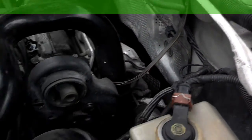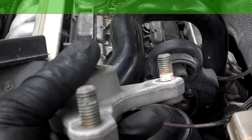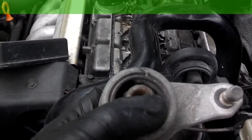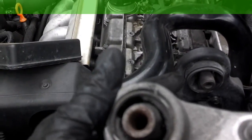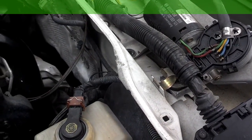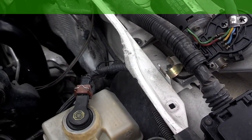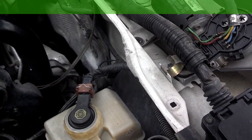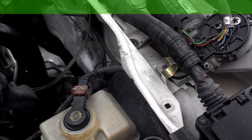After the cowl is removed, you do the 14 millimeter on the bottom of this — this one's from inside the engine bay — and 15 millimeter nuts on this side. This thing was vibrating very bad inside the car when you shifted in gear. So you do want to check these, see if they're blown. If they are, replace them. Put it in place and torque those two 15 millimeter nuts. I don't have the torque value, but my guess is probably either 35 or 45 foot pounds — we'll double check that and put it in the comments below.